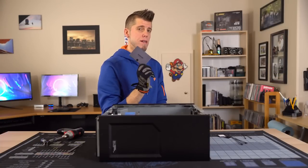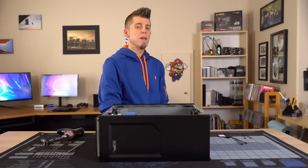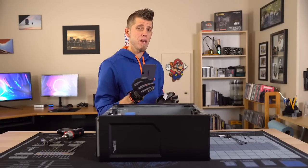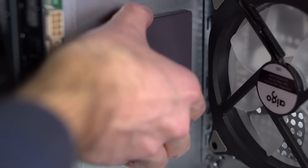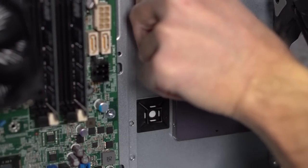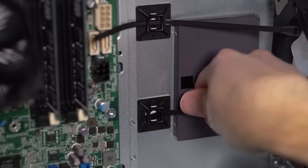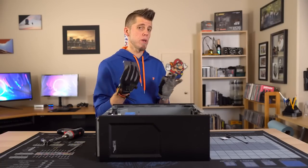Since we're installing this SSD, we need to figure out where to mount it. I like to mount it to the back panel right next to the fan using 3M command poster strips. They'll hold it securely but can be removed easily in case you need to pull the drive out. I also like to leave about an inch on the left side for cable management. I'm going to put down two zip tie mounts and run two medium zip ties so we can bundle up the cables nicely once we get to cable management.